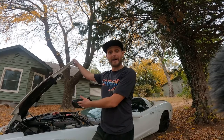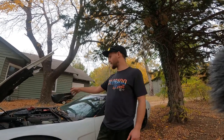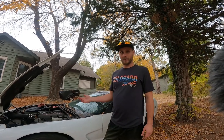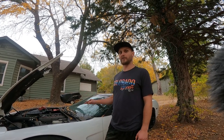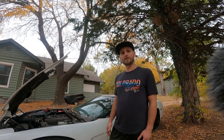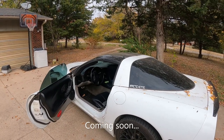That is how you swap out your engine coolant reservoir on any C5 Corvette. You can buy any year of tank — this is a 97 and we bought a 2004 one and it works perfectly. All you have to do is swap your sensor over and you're good to go. That saves you a little bit of money, but if you want the specific year, do as you please. Click that subscribe button, and if this video helped you out, smash that thumbs up and comment below to let us know how your process went or any tips you have.